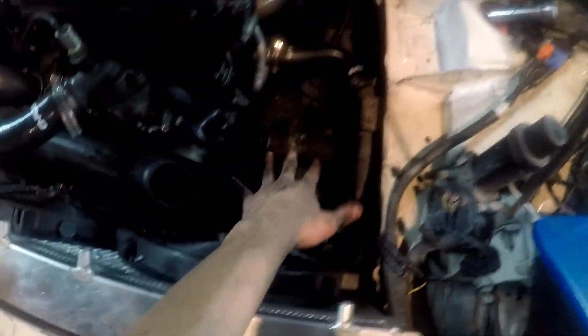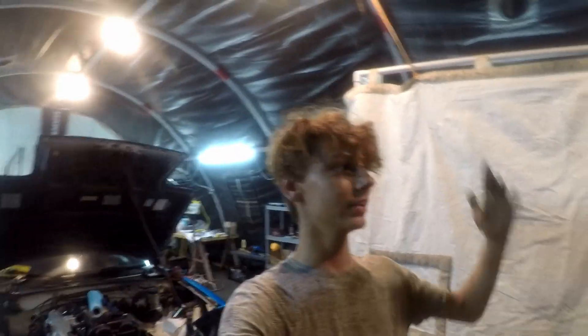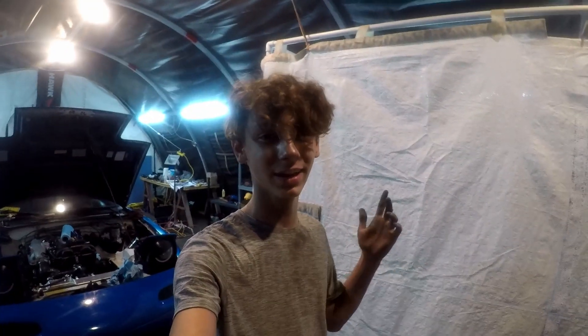A little bit of weight reduction here, a little bit of weight reduction there will go a long way. But the biggest thing is just look how much space we have. We no longer have one extra drive belt, and we have a lot more room to work on both sides because we're not working around the lines or the condenser — it's just going to make life a lot easier. So the question is, should you delete your AC? Yeah, I say go for it. You're going to save a bit of weight and be able to work on the car a lot easier. And honestly, these cars are convertible — if you want AC, just drop the top. This isn't my daily driver, so I don't need AC. But even if this was my daily driver, I'd still probably delete AC. There are some sacrifices, but here in Virginia it doesn't get enormously hot, so go for it. If you guys have learned anything from this video or just enjoyed it, like, comment, subscribe, all that good stuff. I hope you guys have a great day — see you all next time, peace out.